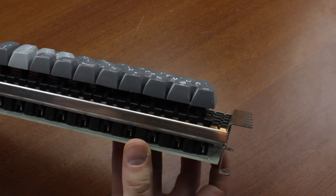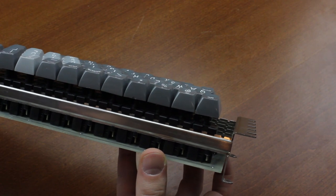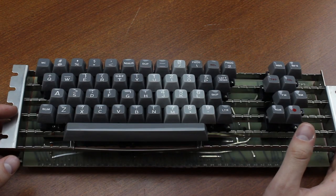Rather typical for a micro switch board, it uses these upstanding edges here as screw bases to fasten the module to the computer unit. Between each row of keys is a rail that the switches grab onto via these blocks, which are fastened to the switch via a pair of long screws — basically micro switch's version of a mounting plate. They used a simplified version of this system for the SW hall effect switch series as well.